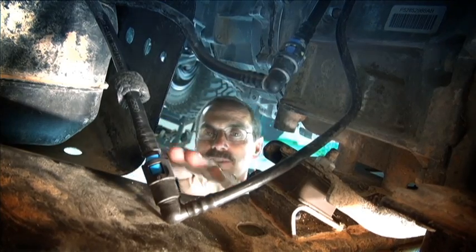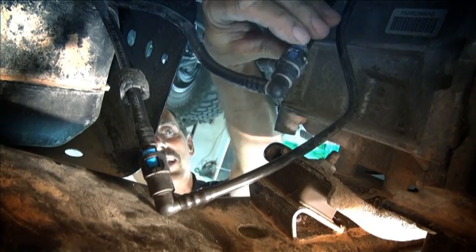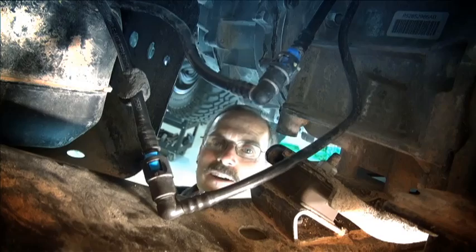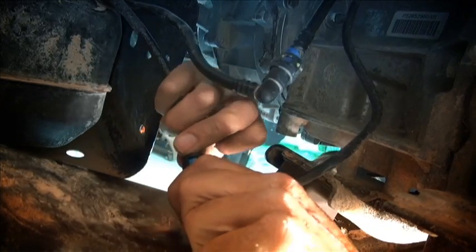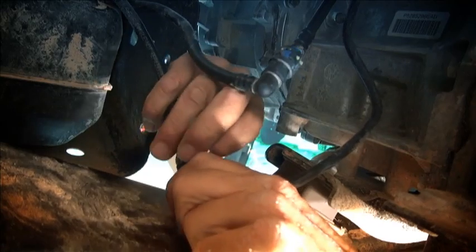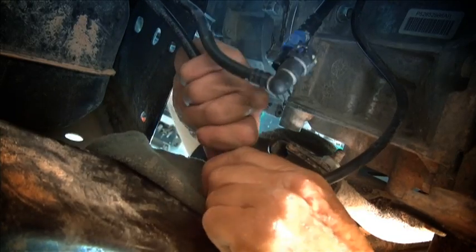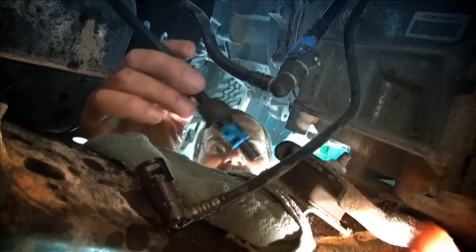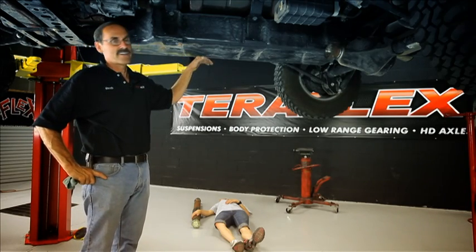The same will happen on the return lines and your pressure line up on the front of the tank — we'll take those off next. They've also got some little disconnects on them. You're going to have some fuel pressure build up in these fuel lines. This is going to be your pressure line and your return line. To get those off they have a little blue squeeze disconnect — you just squeeze that little connector and pop them off. When you go to do the fuel line it's a little more work — same story, squeeze those two connectors together and then just work it past. You've just got to rock it back and forth and slide it — and out it comes. There's a little bit of fuel spill but we caught that. We've got the lines off, we'll go ahead and drop this tank down. If you've done a little prep work and emptied the tank out it'll make it a lot lighter — don't do it with a full tank.